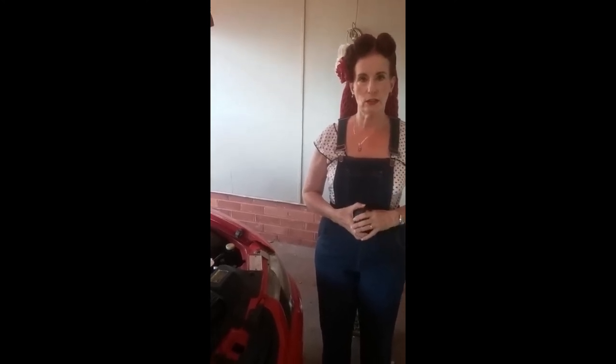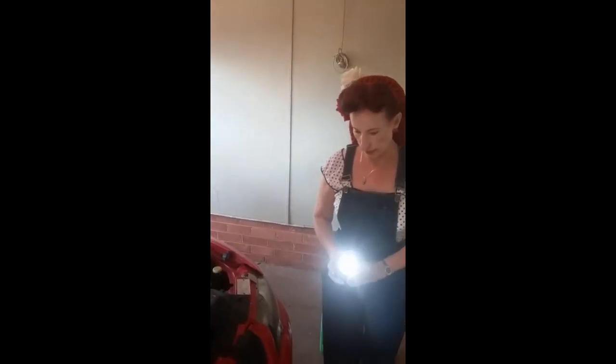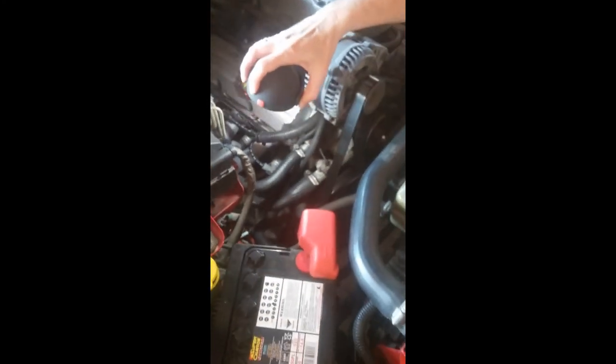Now we're going to check our cooling system and make sure we don't have any water leaks from when we did our cooling system the other week. I'm going to get a little torch and have a look under here to make sure I can't see any drips coming down and also inside the radiator to check there are no wet patches. We'll also check around the back and down on the rails, and check some of the pipes - particularly the ones we fiddled with a couple of weeks ago - to make sure we haven't cracked anything.